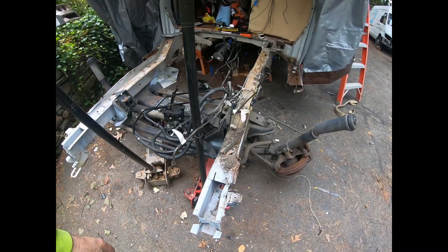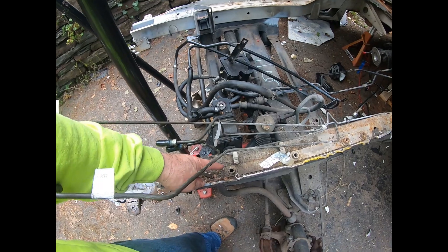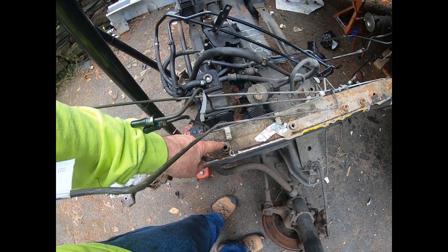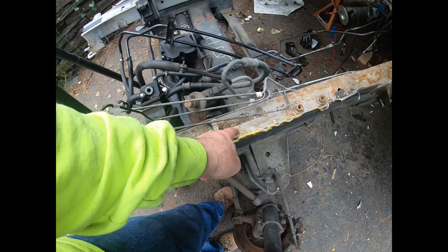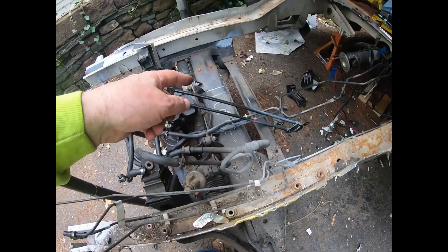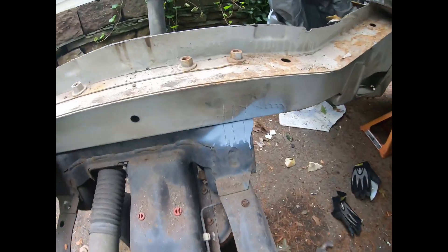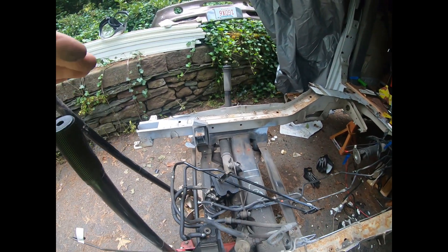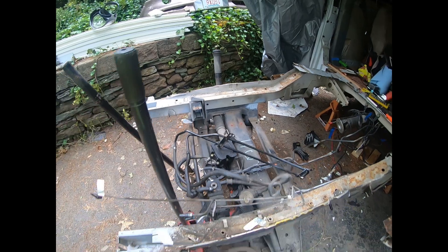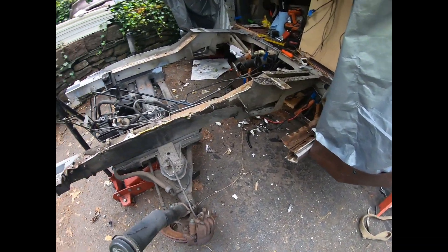When I get the other front end on here, I think what I'm going to have to do is unbolt it — take the welds off of this and save this piece. Then when I put it back together, get these witness marks lined up right here, bolt it down, and re-weld it. Obviously there's a lot more work to do, but this is progress.